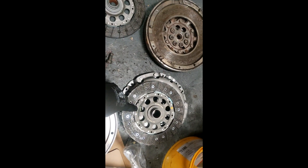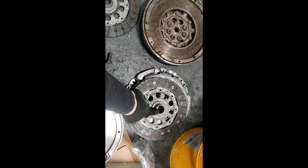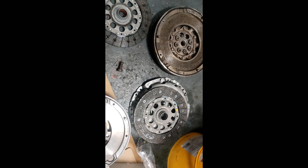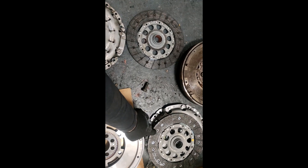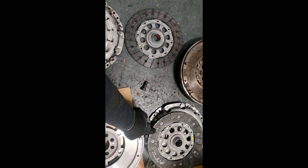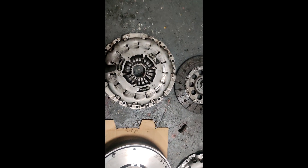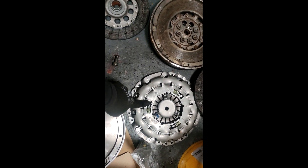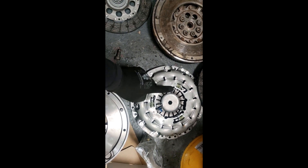Old clutch — as you can see it looks almost identical. That's pretty much a 320D plate but the lining is from a 550. If I were to guess, I'd say the lining on these is probably the same, and I think the difference is probably in the pressure plates. That's the old one and this is the 550 one. This is a transport plate so that's got to come out. I reckon the force on this is stronger and the lining is probably exactly the same.